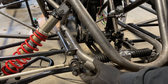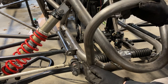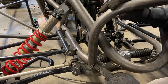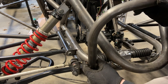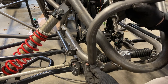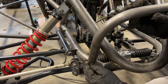This little sleeve works out really well — put it over, it fits nice and tight, and then the notched piece goes on. Since this isn't structural, we can make up our angles and gaps with a little bit of weld. So if your notch doesn't come out right or looks a little weird, don't worry — you can just fill it with weld. Hindsight, I could have used a notcher, but this has a pretty complex angle and I figured a little time with the die grinder would be less than figuring out all the math and creating a cut wrapper.